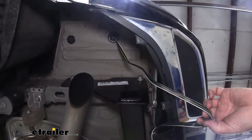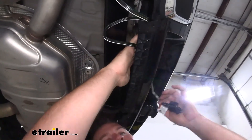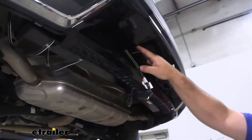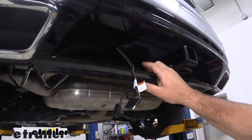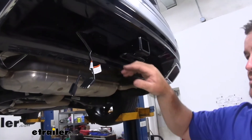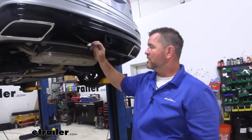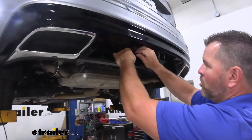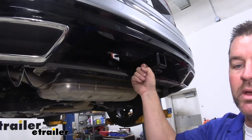Now we need to get our four-pole wire over to the center of the vehicle. I came around the hitch, right up inside here, behind this bracing, fed it over, and it comes out right in this slot here. Now if you're using a draw-tight hitch, it's going to have a welded-on bracket — I suggest getting the four-pole bracket that mounts onto it. If not, you can buy a long no-drill mounting bracket that will secure with a clamp right onto your hitch cross tube and then pick up the four-pole. That gives your four-pole a more permanent mounting location instead of it just hanging or using the dust cap to hang it on your safety chain.